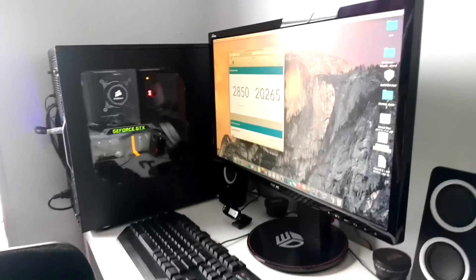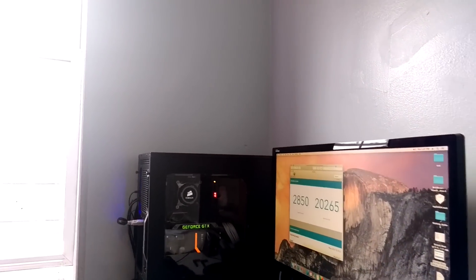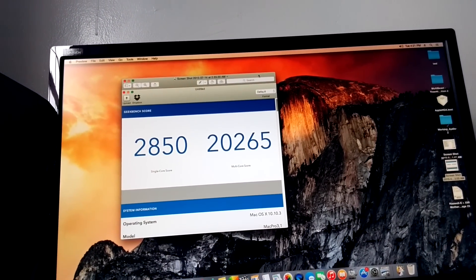There's a problem with the GTX 970 that everybody is having — the driver breaks every time you upgrade OS X to a newer version and sometimes they don't have a driver for Maxwell graphics cards. The best thing to do is keep a Kepler GPU around, like my GTX 770. It's a great GPU for Hackintosh builds — anytime Apple releases an update, that Kepler card will work right out of the box. So I use the GTX 770 normally and throw the 970 in whenever I play games.